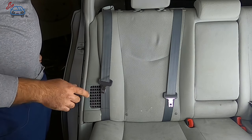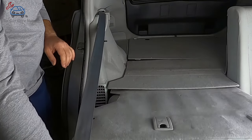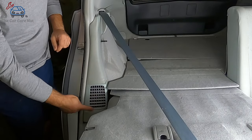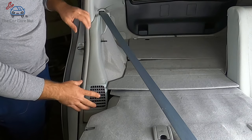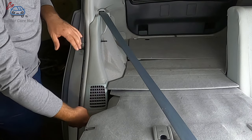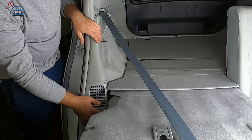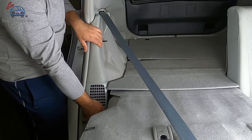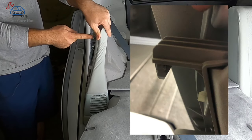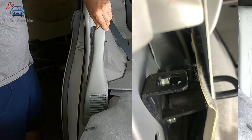To replace the filter that is behind the vent, we're going to come to the passenger side of the rear seat and fold the seat back like so. The vent is right here. In order to remove this piece to expose the filter behind it, you'd normally have to remove the bottom of the seat to get to a bolt — but here's a little trick: hold this whole piece, put your hand underneath it, and lift up while pulling on this piece. There's a hook right here that hooks into place — all you do is pull it up to unhook it, and now it's open.